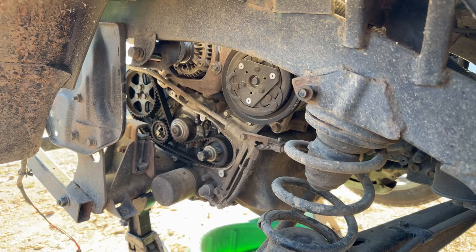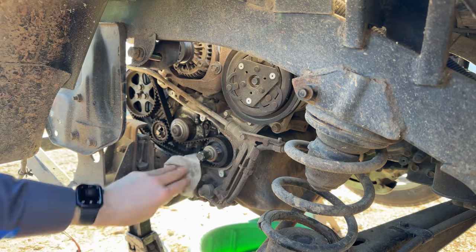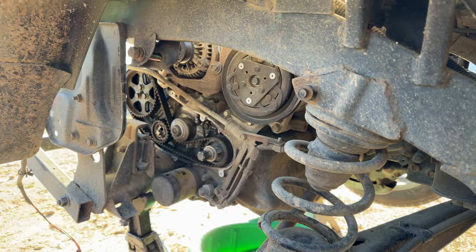Motor mounts, please check, and transmission. Yep, that's what I would suggest. Check the other mounts. It might not be the rear diff mounts. It might be something else in the driveline causing that to feel like it's coming from elsewhere.